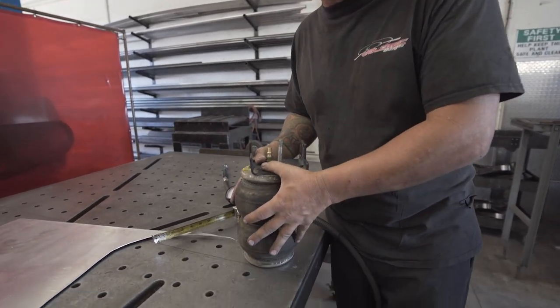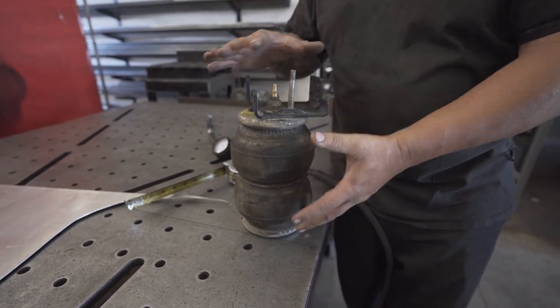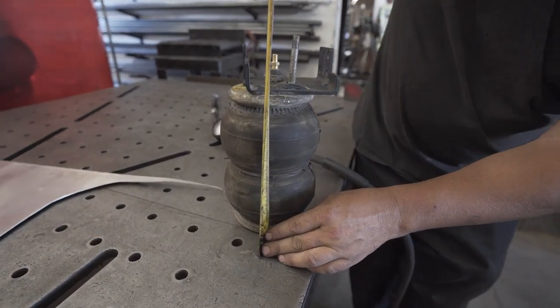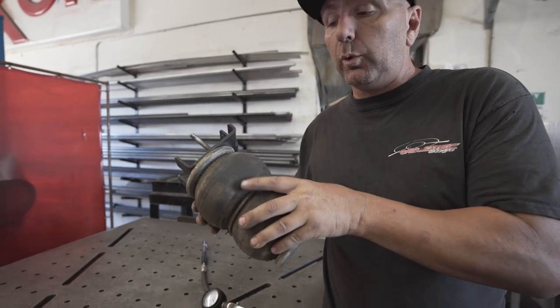When this is mounted on your RV, it's not going to move. Yes it's going to hold it up, but it's also not going to allow your vehicle to articulate. Now when we measure this, we're at nine inches — we were at three and a half — so we got about five and a half inches of movement. Typically in one of these RVs we're getting 10 plus inches of travel and articulation out of the back. By doing something like this we've cut that in half just to cheat it up a little higher and give it a stiffer ride. The whole point of lifting your RV is to improve the suspension, and this really isn't going to do that.